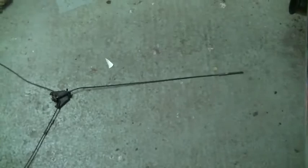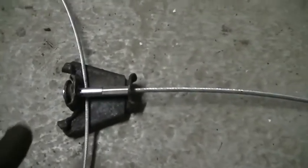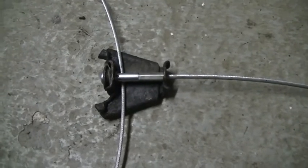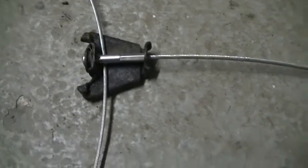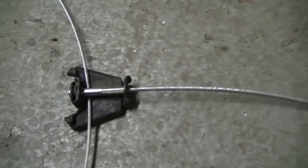Right, so here's the cable on the floor. That's the handbrake end. That goes to the front of the rear subframe, and then we've got the two parts that thread through. So this is what we're going to replace. Right, and that's our new cable together using the original bracket. I always put a couple of washers on the back just to give some extra adjustment. Just don't go too mad, because obviously you need the front to be supported by the front of the bracket.